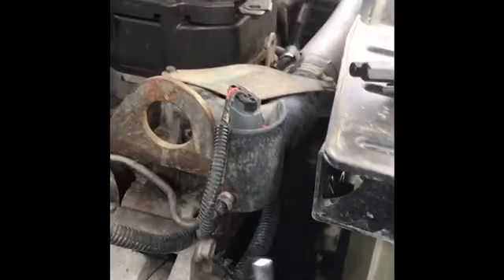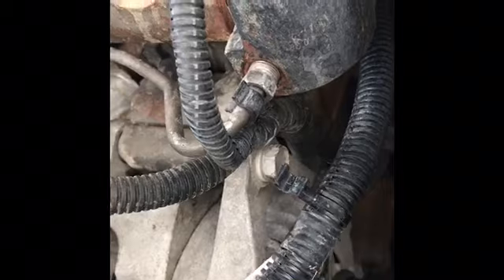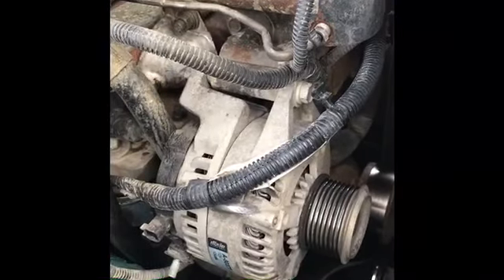To keep it simple, I put the belt back on the pulley down below so it won't come off and you don't have to remember where it goes — just slip it back over the alternator. Then with another 15 millimeter ratchet, crack those bolts off and we'll be good to go.